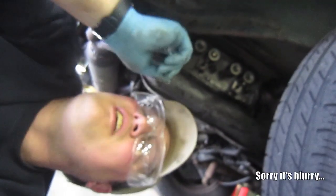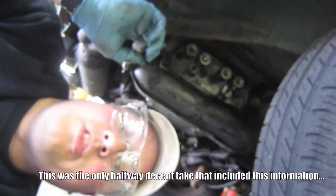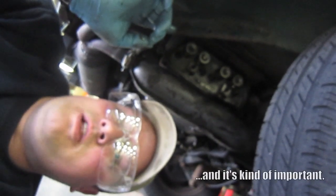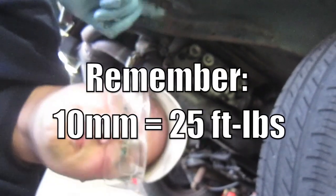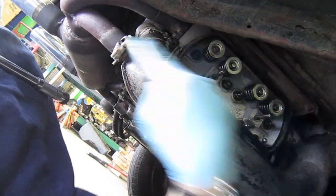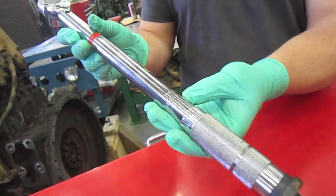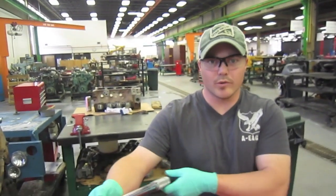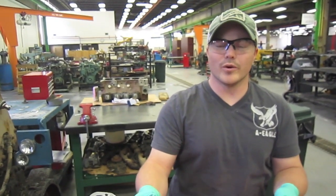Now this is where we're going to use the torque wrench. That head stud needs to be tightened down to 20 foot-pounds for an 8mm stud, or 25 foot-pounds for a 10mm stud. You'll be able to tell which is which because the bolts that hold on the rocker arm assembly are 8mm — so if the head studs are bigger than that, they're 10mm. Mindy's are 8mm, so we've already set our torque wrench to 20 foot-pounds. As you tighten these down, don't start at one end and work your way across — start with the middle two, then do the outsides. When dialing in your specific torque, always pull, never push. When you pull without bouncing, it'll give you a click letting you know when you meet your torque.